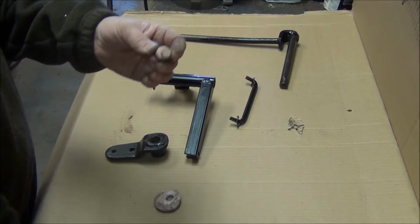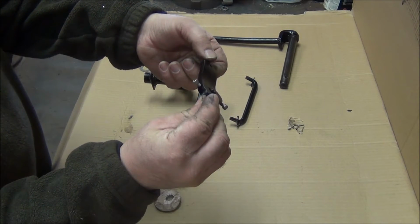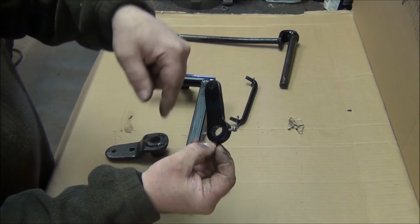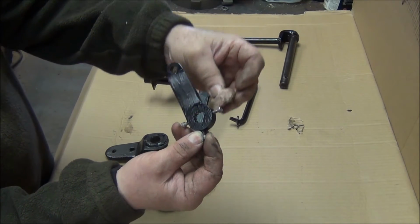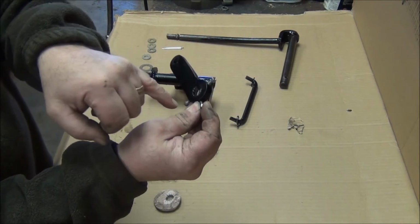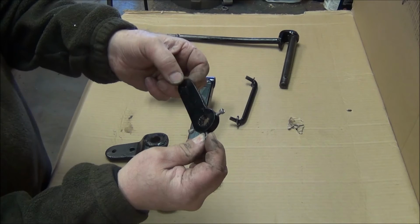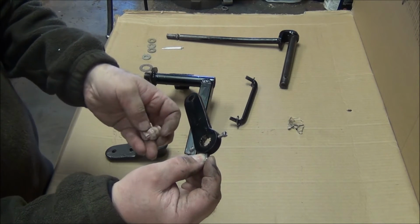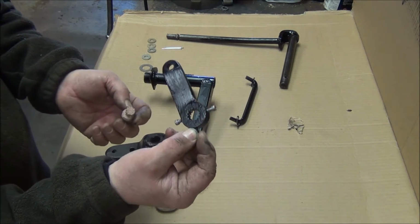So taking this, I took a piece of steel, about 3/8-inch thick, roughed out about the size of what I wanted, drilled a 1/2-inch hole, and then took this piece, held it behind, and very carefully marked out one spline at a time, and using a hand file, worked my way through. There were a lot of times in and out underneath of the truck to get it to fit, because I didn't want it to be loose or overdo it, which I had done in the past. So just very carefully marking this out, climbing underneath of the truck, it actually fits pretty well.